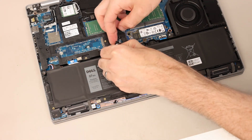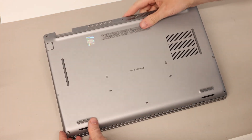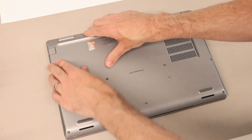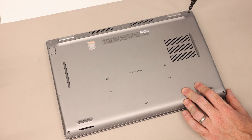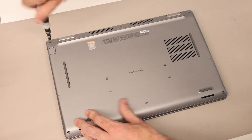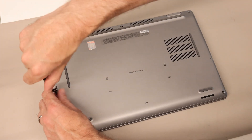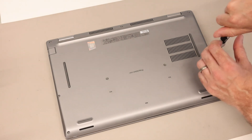With all the work complete, reconnect the battery, take the base panel, align it on the front, lay it flat, and press down to re-engage the clips, then screw the base panel back on. I hope you found this video helpful — if you did, please give it a like and let us know in the comments what you were able to replace or repair. If you want to help contribute to the making of these videos, there's always the option to leave a super thanks. Hope you enjoyed watching — have a great day and thanks for watching.